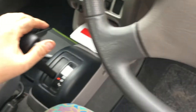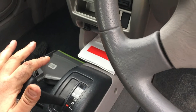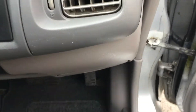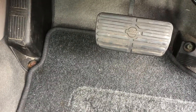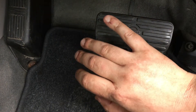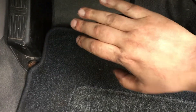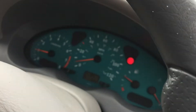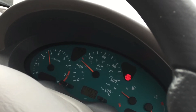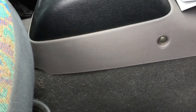Then hold on the brake and cycle through each of the gear selections — reverse, neutral, drive, and low. If you've got the older powder clutch version from pre-2000 models, that'll be park, reverse, neutral, drive, and a couple more. Because the wheels are spinning, press the brake pedal while going through each selection. If you don't — a mistake I made earlier — you can go into reverse and then park and hear the parking pawl making a horrendous noise. So always press the brake pedal.